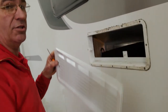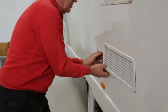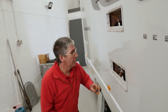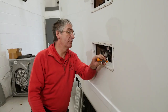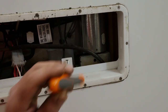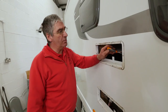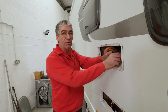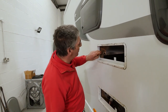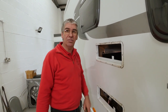This is where we do the fridge service. Not every workshop includes a fridge service as part of the habitation inspection — they ought to, but some don't. So it's worth checking when you book your habitation inspection whether they service the fridge or not. The fridge service basically consists of cleaning and checking the burner and the flue. On this one it's just about accessible. Sadly, not all motorhome makers put the fridge vent in a position where we can get at the burner in situ. Up here behind the top vent we have the flue outlet — that needs to be removed so we can clean the flue and make sure it's not sooted up. It's also worth a quick visual inspection to make sure this compartment is sealed from the interior, as we don't want flue gases getting inside where they could do us harm.